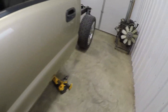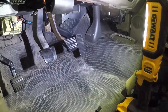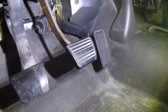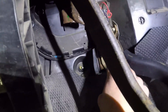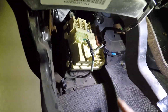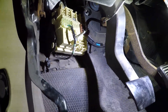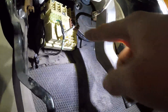This video I really just wanted to show how we mounted the pedal, since I hadn't seen a video on YouTube showing how anybody did it without changing the entire brake pedal bracket. There is the pedal mounted, and the wiring plugs in there and runs in this factory channel right here just like factory. That hole saw hole ends up right above and behind that block, so there's nothing to hit when you drill with the hole saw and run the wiring through from the inside out to the firewall.